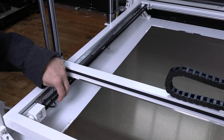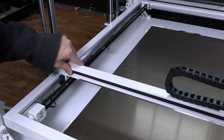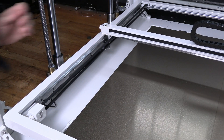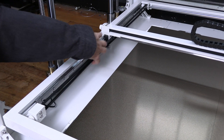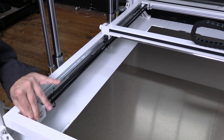To get a better feel, make sure you're not testing it with the printhead right in front of you. Slide the printhead back a bit and then get a good test, feeling it along the way. If it's super loose and springy, give it some more turns.